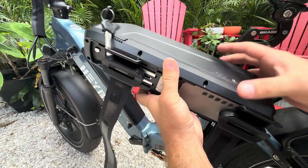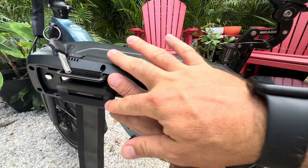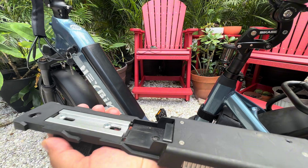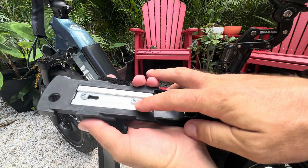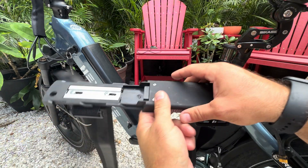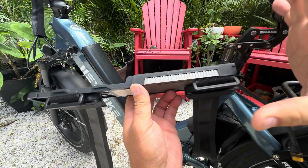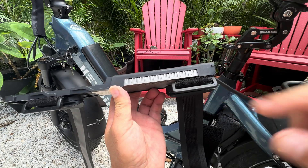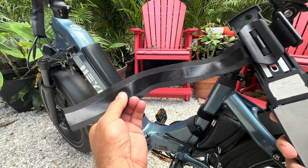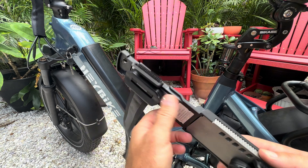It's important to remember that I'm utilizing the Bike Case bottle cage strap adapters. These strap adapters come with a factory screw that does not fit on this mounting plate, so you'll need to get a couple of aftermarket screws — we'll leave a link — so the battery slides over this plate. The factory screw is used on the rear one just for support, and it helps hold the mount. The straps are extra thick with a slip-resistant coating on the inside, and they mash down for a secure final fitment.